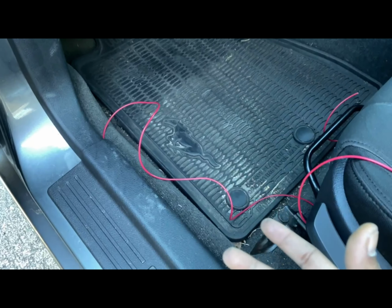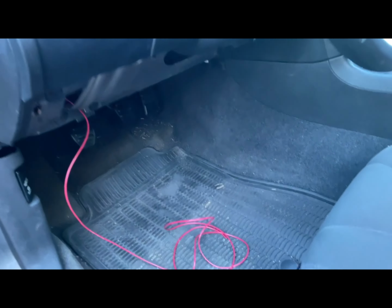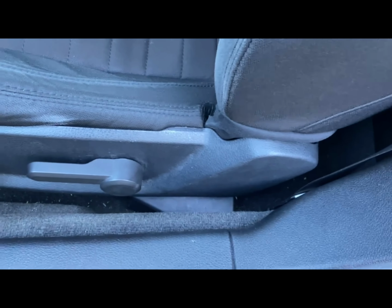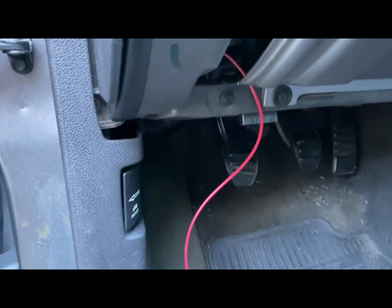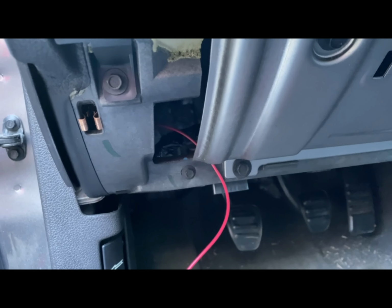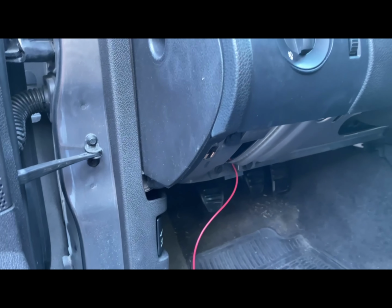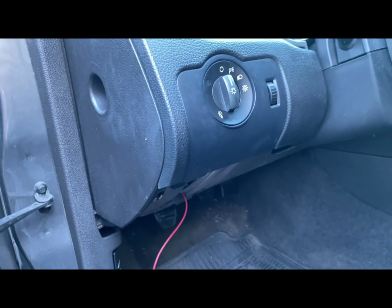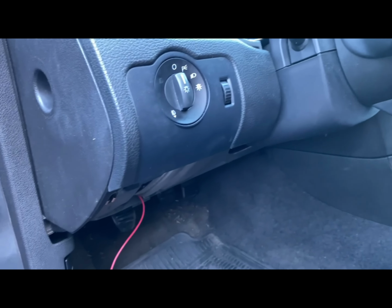And then from there, we can wrap everything up, connect all the cords, and we're done. All right, guys, so here's a complete look. I probably should clean my car whenever I get a chance. But we ran the wire all through the seals and brought it up and out through there. So now we're done with that positive from the rear. Now we just need to splice everything up under the engine near the fuse box, connect everything to the button, and we're done.